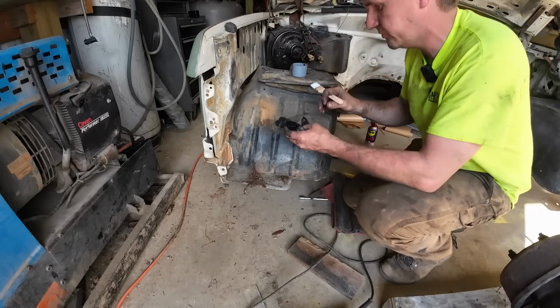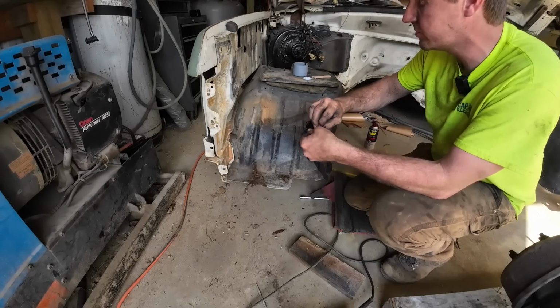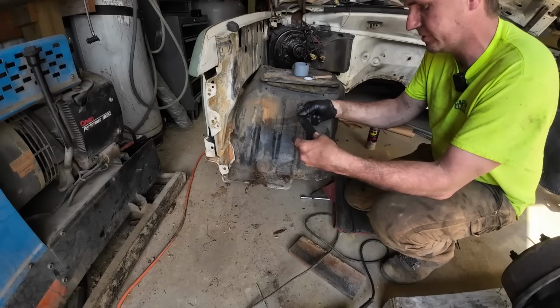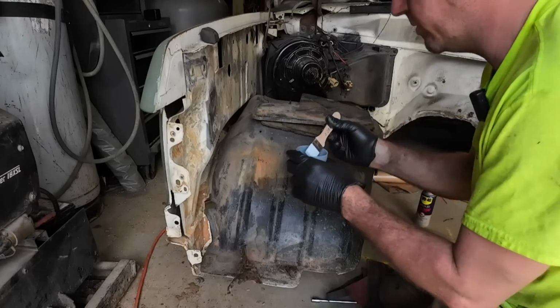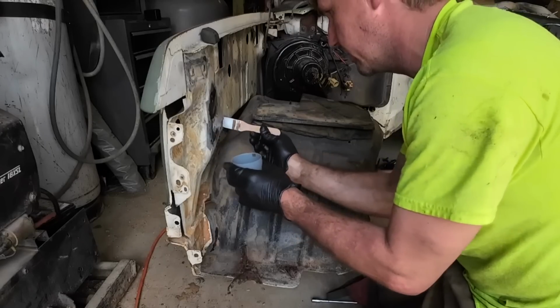So I'm using this OSPO, which is that phosphoric acid, essentially, and some other chemicals. It's supposed to stop the rust, convert the rust, and give you a paintable surface. Neil Coe from Dig Drive DIY turned me onto it, and I have fallen in love with that. It does recommend about 24 hours before you paint it. So we're going to get this on here tonight.